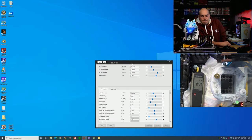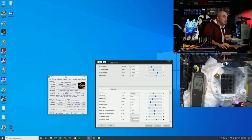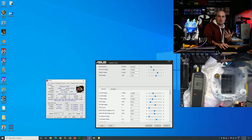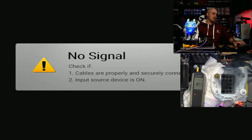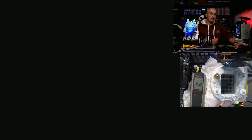Okay, so we have full pot again, and it seems the issue before wasn't the FCLK, it was another thing in the BIOS. I don't know, but so far it's doing good. So I don't even bother to test it in Cinebench. I just want to restart and raise the FCLK and see if we can keep rising, because maybe it's not the fastest one in multicore, but if we have a good FCLK, I can compensate for other CPUs that are slower. Frequency isn't everything.